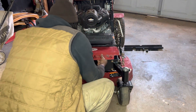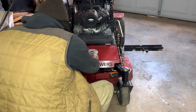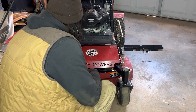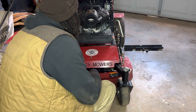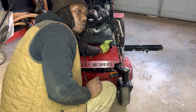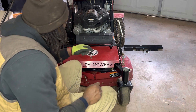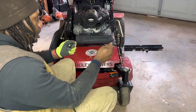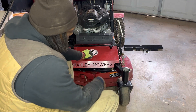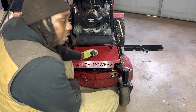Got to put this back on. Then that side plate goes back on. I'm trying to give you a quick video — I'll edit it down to about 15 minutes. Like I said, it was pretty easy. The only thing I struggled with was loosening this tensioner screw to fix the spring and put it back on. When putting the belt on the clutch plate, you got to kind of turn it and guide it on — just like putting a chain on a bike. If it's tight, you turn it on and it'll roll on. I had to get it from the side. This is a real easy job — it'll probably take about 10 minutes, no more than 15.